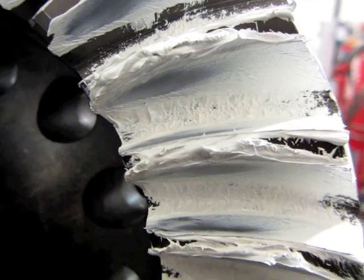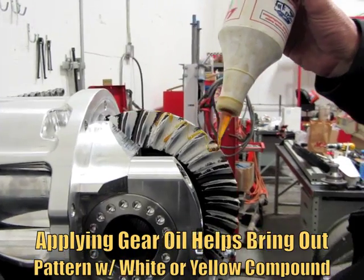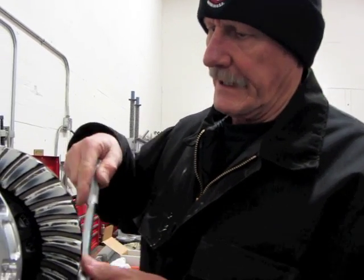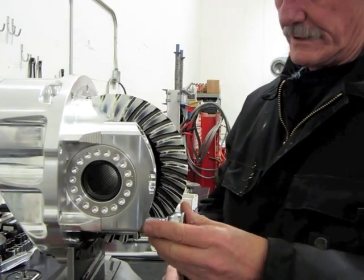Other gears are a little harder to read, and what you can do is you can cheat — put a little oil on here. Now we've got the correct backlash, the correct bearing preloads, and the correct pattern, so now it's a piece of cake. Your spanner is marked with your cap over here, so all we have to do is loosen the caps, back that spanner out so we can get the pinion back out, install the third member studs and O-ring on the front retainer, torque everything down, and you are ready to run.